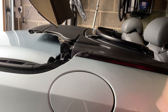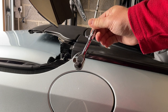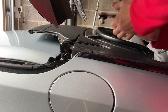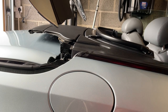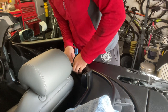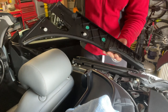To get at that bolt, put the roof back down into the trunk so that the flap folds down — that means the bracket allows you to get a little ratchet and an 8mm socket in there, and you just loosen this bolt a tiny little bit. That frees up the panel so we can now go and unclip this and take it off. There are the two clips — uno, dos — and I'm happy to report I haven't broken any of them.